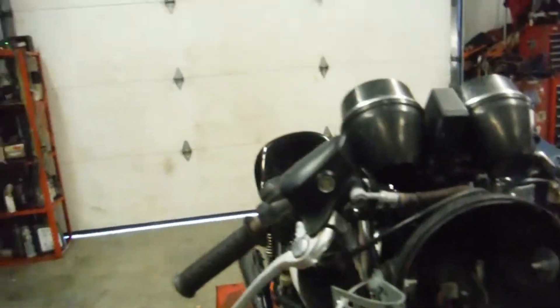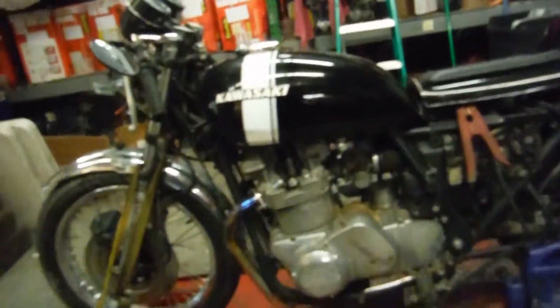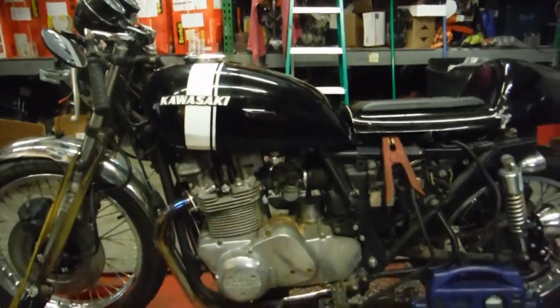As far as the voltage regulator issues, what happened is I started losing a whole bunch of my lights — the headlight popped, things along that nature. The bike's been sitting for several months now. I just brought it in today and I'm trying to get it running, but I'm not getting any spark — just an occasional hit — so unfortunately she's not firing. I hit it with a little bit of ether and got nothing.